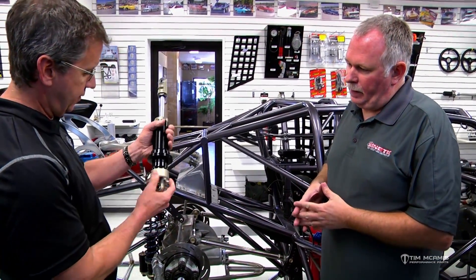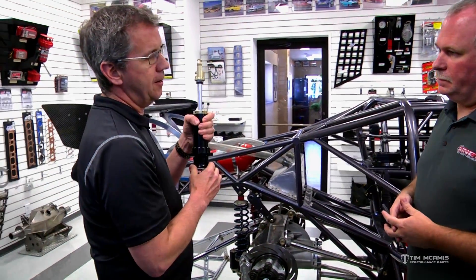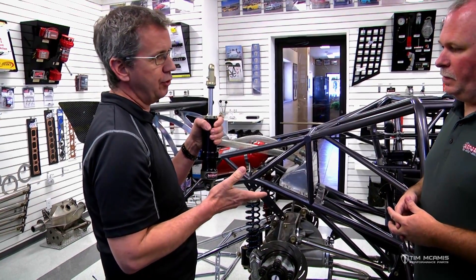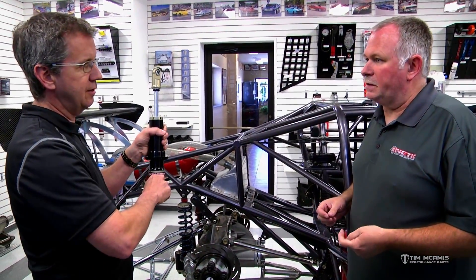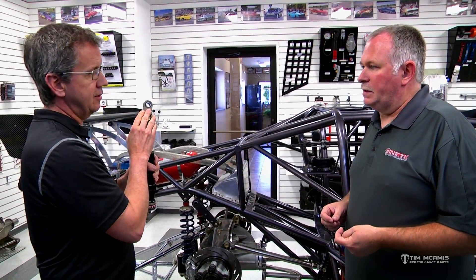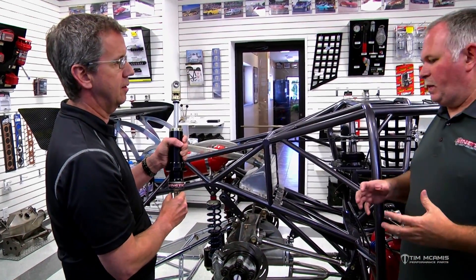So if I've got this shock on the car here, I've got my compression here and my extension up here at the top. If I've got it mounted like this, I want to loosen up the compression setting by a couple of clicks — two clicks is where a noticeable move will start. So I would go counterclockwise two clicks here. And then I'm going to do sweeps up here on the extension — I'm going to tighten that, going from right to left on this shock, two sweeps. Two sweeps is where a noticeable move happens.